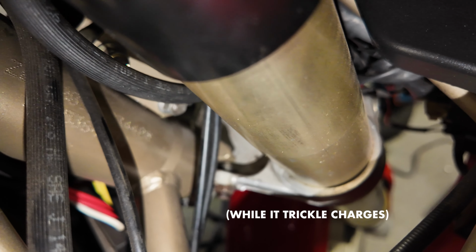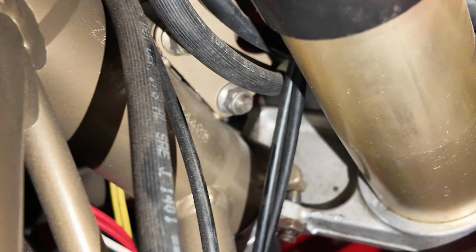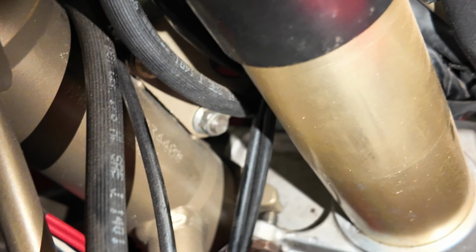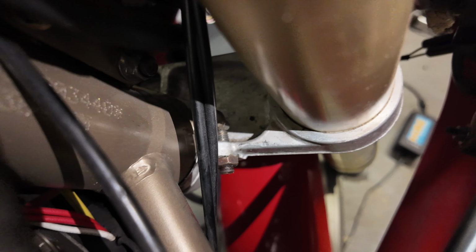So the next thing I need to do is fiddle with this steering adjuster, if that's going to focus, just in there. So there's a Torx bit that you put in the end of it, and then you can see there's a little nut on the end of it there, so I've got to push it through a bit more because as you can see it's fouling. Obviously you don't want your brake hitting that, so I think we'll only need a little bit more and then that should clear nicely. But yeah, I'll do that while the battery charges.